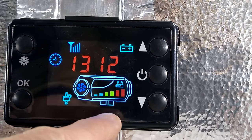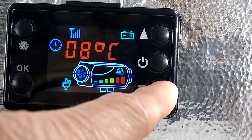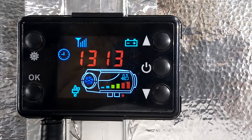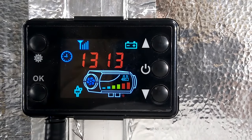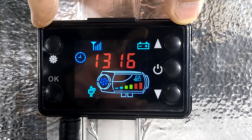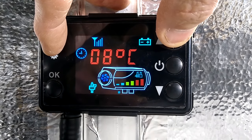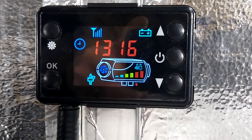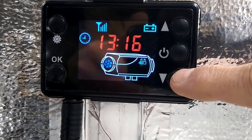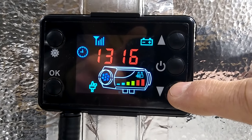Let's turn this unit from Celsius to Hertz mode. You push both buttons simultaneously. You can see the P and it's at 1.2 — that's the Hertz setting. Each Hertz is one cycle per second of the pump. So 1.2 Hertz means 1.2 pumps of the fuel pump per second, and that's its lowest setting on this unit. You can hear that it should be getting quieter and the fan has slowed way down — that's the most fuel-efficient setting.